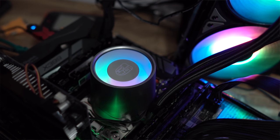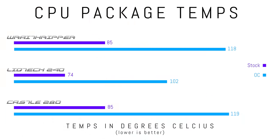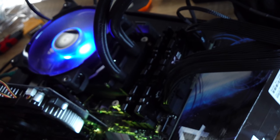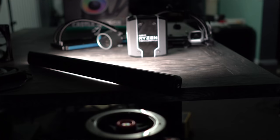The Castle 280 performed well, and so did the Threadripper air cooler, so all three solutions will do a fine job of cooling the 32-core CPU at four gigahertz. Now going above four gigahertz — if you want to go to 4.1 or even 4.2 — I would recommend getting active VRM cooling and probably quite a sizable amount of it, as well as going with a bigger cooler, say a 360 or even a 480mm rad, because this CPU puts out a lot of heat, consuming 400 watts directly at a four gigahertz overclock. If you're going even higher, diminishing returns start to kick in and it will use more power past that four gigahertz mark. So do keep that in mind.